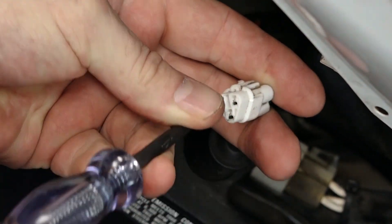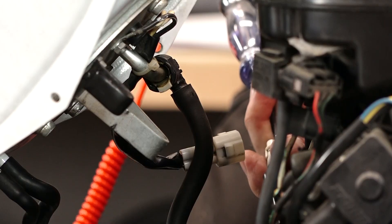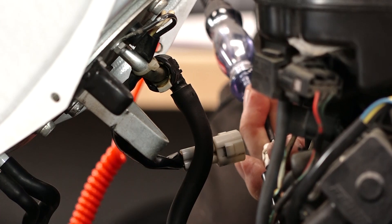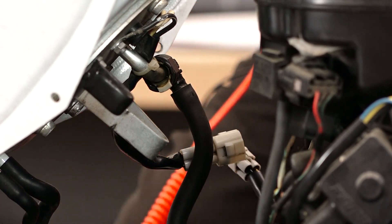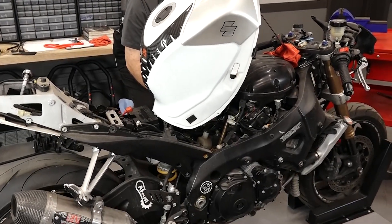So we're going to unplug it and see if we're getting voltage there when we turn on the key. Remember, it's only going to be powered on for a couple of seconds and then it's going to go off, if it's working correctly. There it is, and now off — plus you can hear the relay clicking. So let's go ahead and get the tank disconnected and we'll put it over on the teardown bench and get that fuel pump out.